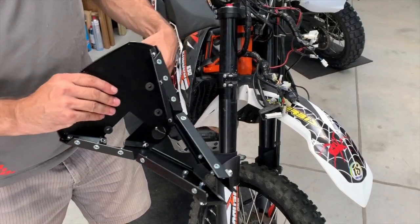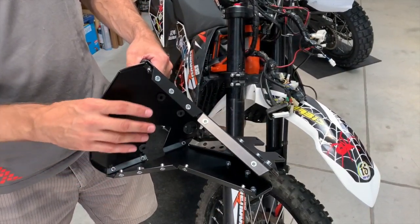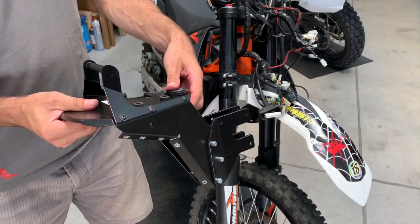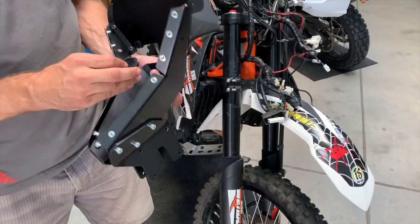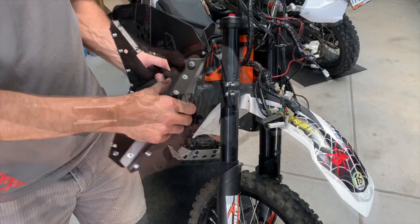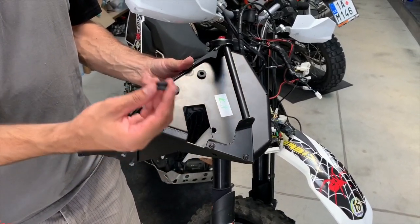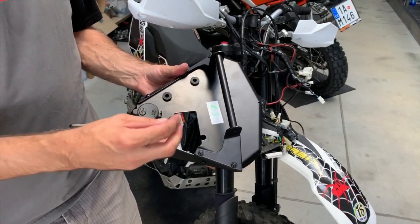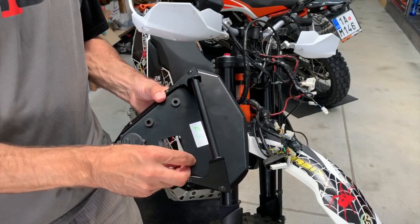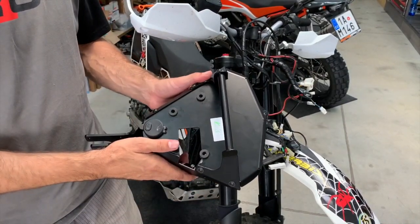Guys, at this stage you remove the headlight holder and the covers from the tower, and you insert the USB portlet. It's easy, and you secure it from inside. These are the original grommets holding the speedometer. So take all three of them and insert them in the holes on the tower, like this.